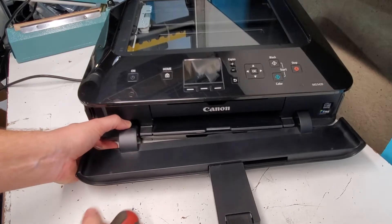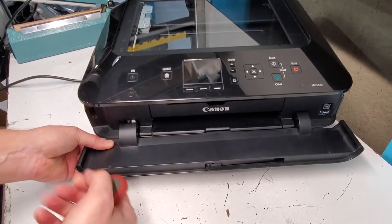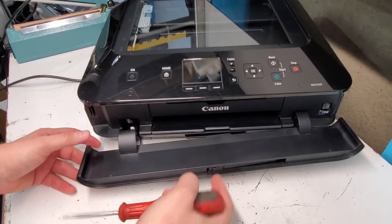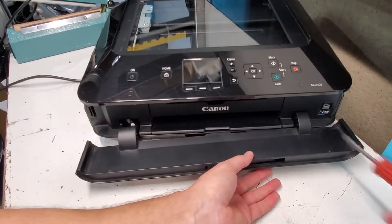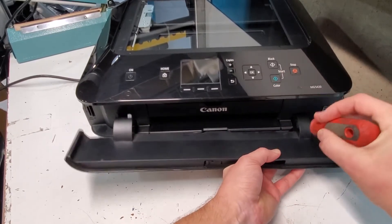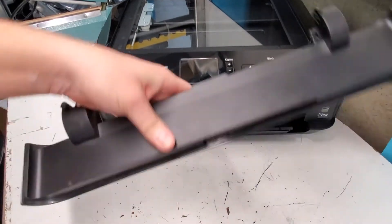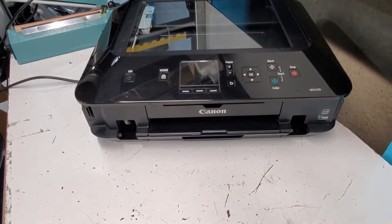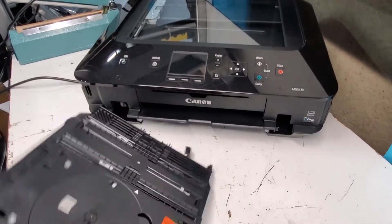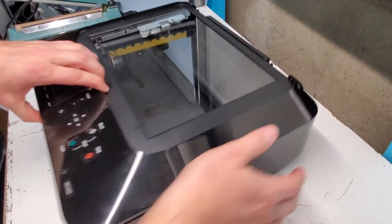When you're putting a new one in or replacing it, make sure the tray is in the open position and move this tab over before you push it in, because that's where it needs to be in order to work properly. Push this in right here to get this side out — there we go, simple as that. Main tray, photo tray, and we have the CD tray right here.